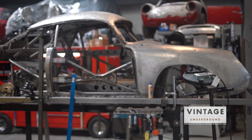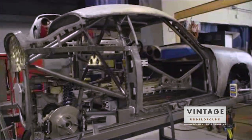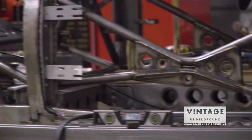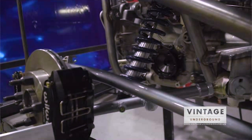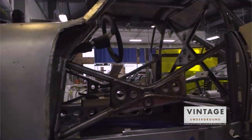The core of the car is now a full cage front to rear. We have tied it into every aspect of the car — the cage is structural to the car now. It will provide protection in the event of a crash or an off. There's a cost to this of course, and that is added weight. We used chromoly tubing so we were able to use less mass, but it still added weight that we now need to deal with.